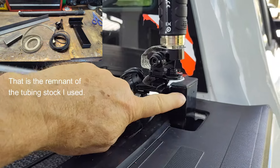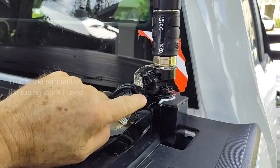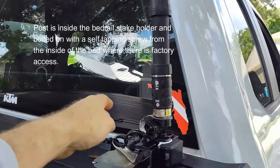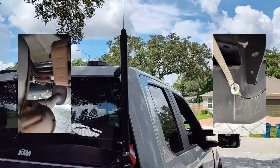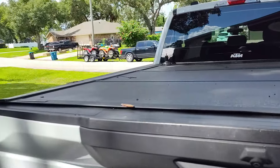I've got everything ground bonded. I welded up this bracket — it's one-by-two inch square tubing with one-and-a-half inch angle welded on. This is a standard trunk lid mount screwed onto here. You can see I've got the one-and-a-half inch braid going down to the chassis for a good ground. I'll throw some pictures in of all that.